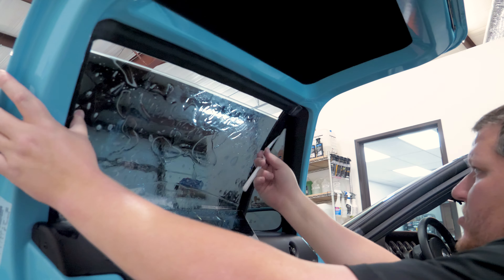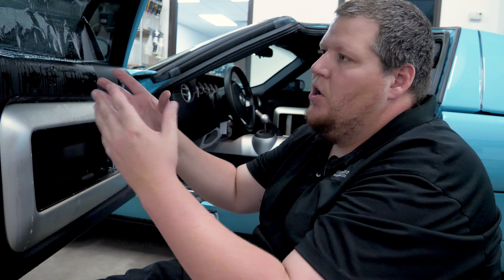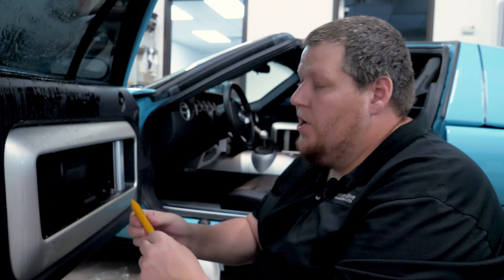You want to have a little bit of a gap because the window will roll up into the seal — if it's too far up it'll catch and rip off. I've got the whole top secured, rolled up the window, and now I'm doing the bottom edge. I have a liner here protecting it from picking up any dirt. I spray underneath the tint and then tuck everything in. This process is called two-stepping or two-staging — this is what I do when it's a tight fit or the bottom seal can't be pulled. It's the only way to get a clean install and tuck the bottom edges. I always spray the window so my squeegee can slide through without catching and creasing. We put 'do not roll down window' stickers to remind customers to let the window cure for 24 to 48 hours.